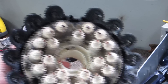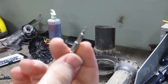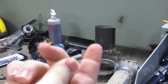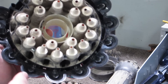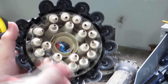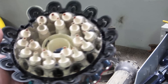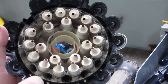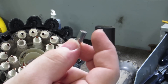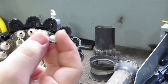Make sure you have proper tools for this. This is Torx 8 and I'm using a small interchangeable Torx 8 bit from an iFixit set. These are relatively deep and tight cavities on this part of the canister that hold the screws. The extensions won't actually fit down in the cavities — this is the only bit that will narrowly fit and you have to put a bit of force behind it. It's also not really long enough, so what I ended up having to do is hold it partway out of my cordless drill, clamp onto it, and go.